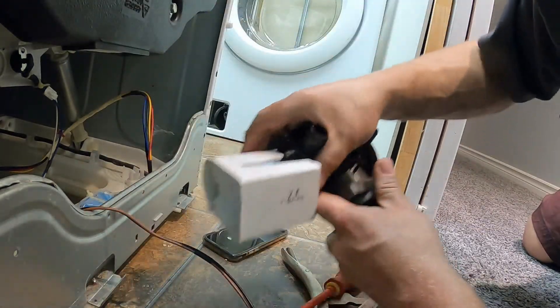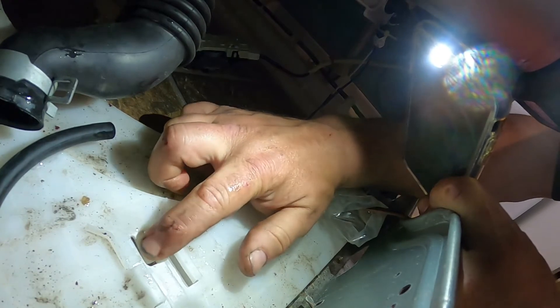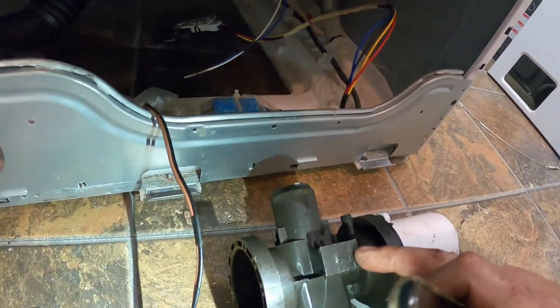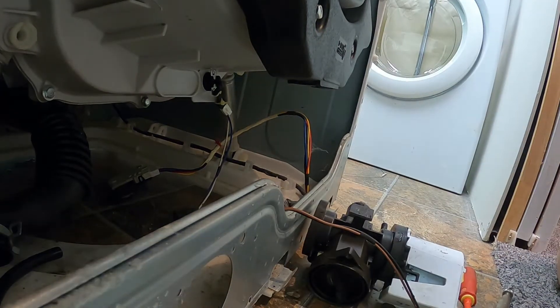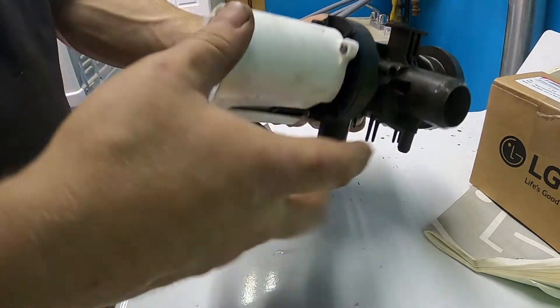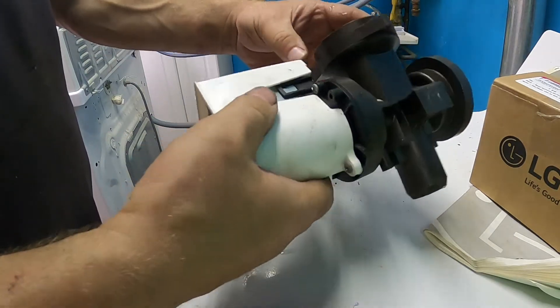So there we have the pump. A little trick to get that out — there's a little tab that you have to push down right here with your finger. You just have to push that down in order to slide that out the bottom, because there's a little piece right here that goes into that groove right there. So you've got to push that little tab down in order to slide that out. So what we're going to do is change this pump and put the new one in. You'll just want to remember the orientation of this pump, because you have to watch which way it comes apart — with the rotation on this pump housing. The flat side here correlates to this.